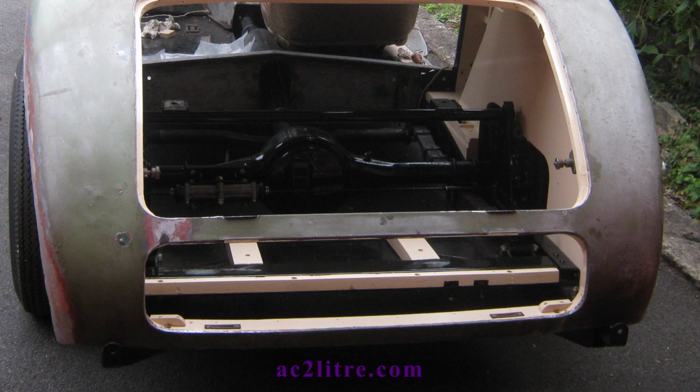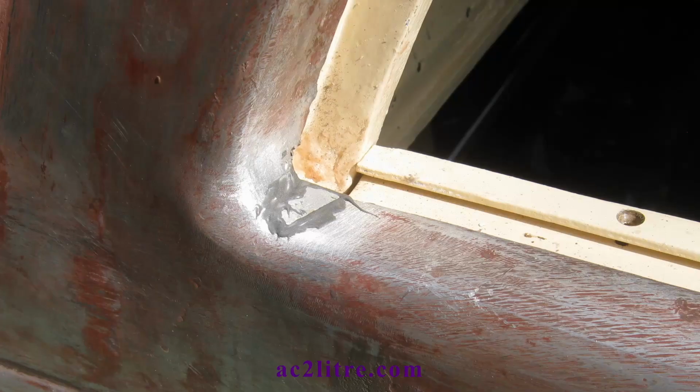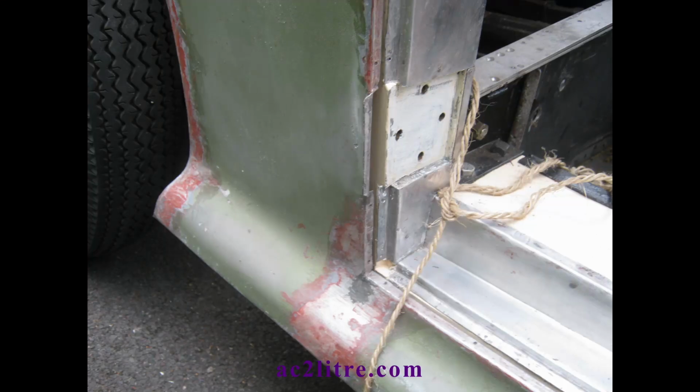We lifted the back and got it almost in place, but the rear window surrounds were reluctant to go in. It was showing that it was never designed to be fitted as a complete shell. Two areas that I knew would be awkward were the rear corners of the side windows. As these edges cannot be unfolded, we had to pull out the sides enough to get past the frame. After some persuasion, it popped in. Still not exact, but close enough to be able to tie the sills safely to the frame to prevent damage when moving the car.